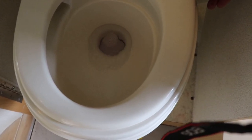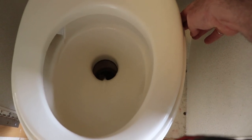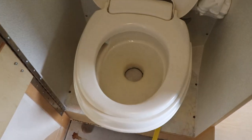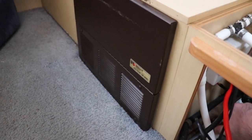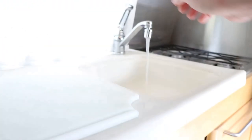I noticed that the winterizing fluid I used this year changed color — it kind of went clear over winter, I've never had that before. You can fill the bowl by pulling the lever part way, then pull the plunger. Sometimes the first time of the year the flapper gets stuck and you have to poke at it with a stick to get it to go down, so it's better to do that before you use the toilet. If I want to start filling the other tank, I would just flip over to here. The water is going in and the drain is open — I better turn this off before I fill up my gray water tank.